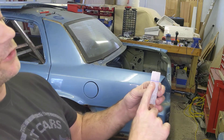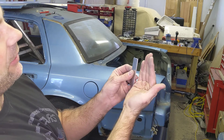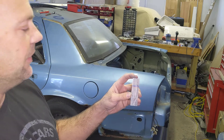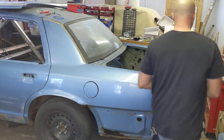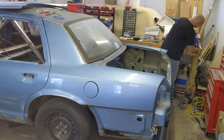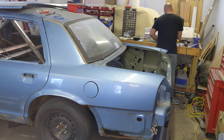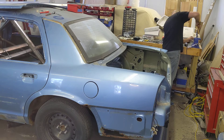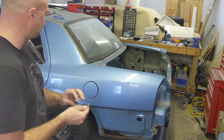So that's my one-inch mark — that's the line I drew. Being a little bit short is fine because up top the sheet metal bends over, so being a little shorter is better in this case. I'm going to bend that up really quick. All I do is set it in my vise and pound it over with a hammer.